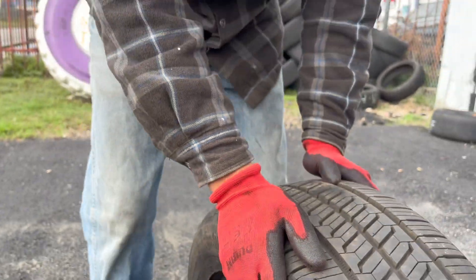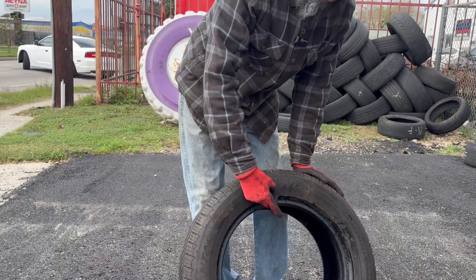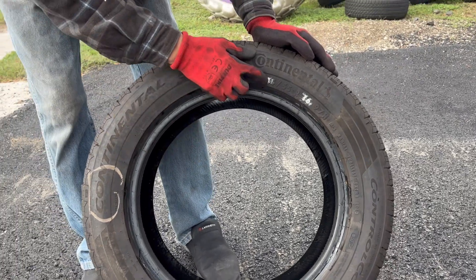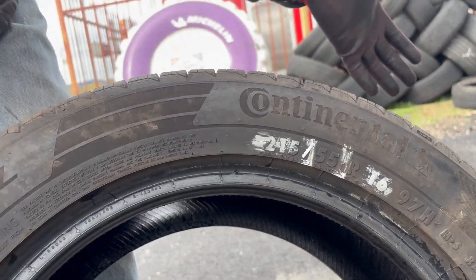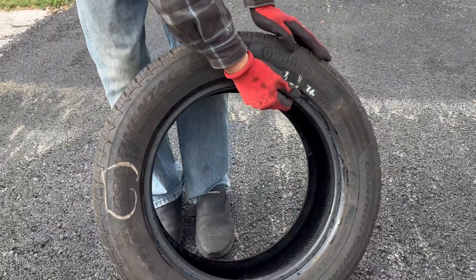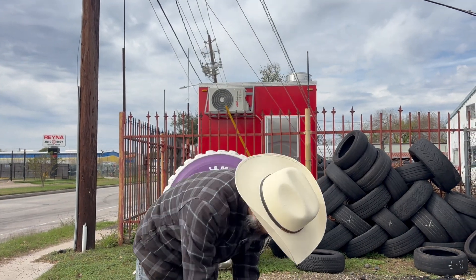The 215 is going to be how wide the tire is, and the 55 is going to be how tall — how narrow your sidewall is. The bigger that number, the taller the tire; the smaller the number, the lower the tire. Something I've seen very commonly: when I ask folks for their tire size, they'll give me 215 and 16 but leave out the 55. Without that middle number, I don't know the full tire size. If I guess and give you a 215/65, that tire could rub on a small car.